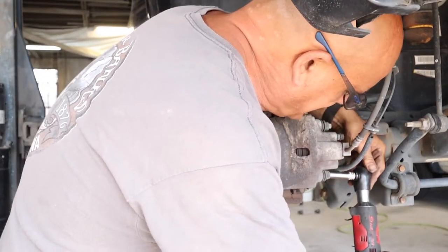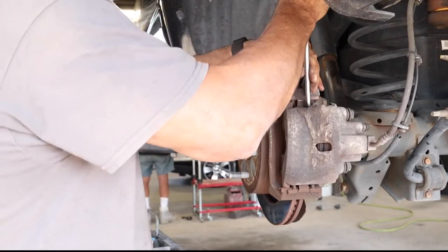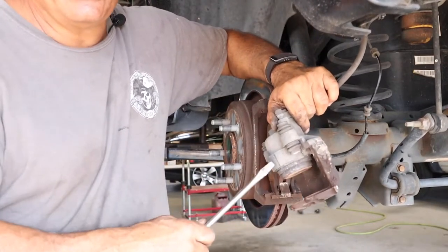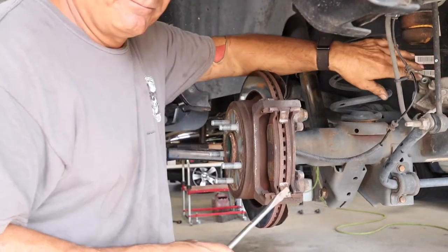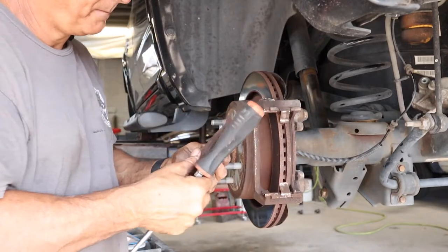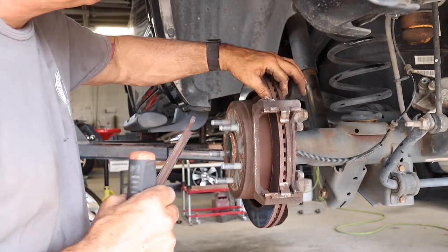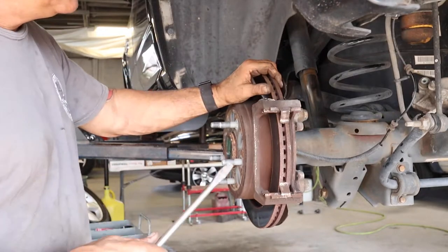The caliper is held on with tens. We're going to have to pry this one off. It doesn't come off by hand — just get a pry bar, go in between here and slowly pry it off. If you're going to be reusing the calipers, don't let them hang. It's not good for the rubber brake lines. If you can safely set it on something, just do that. If you can't, get a wire tie and tie it up. You still have plenty of meat there, but with the vibration that he's feeling, and if you feel the rotors, you can definitely see they're messed up. I don't even have to mic this one to tell it. That's going to be his pulsating brake pedal right here. This is some of the noise I was talking about that you're going to be hearing through this video — I apologize for that.